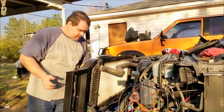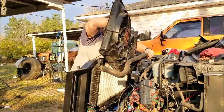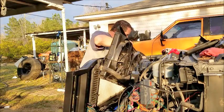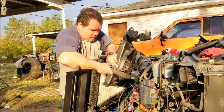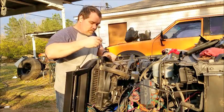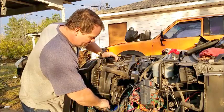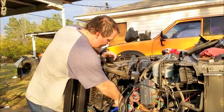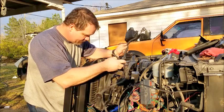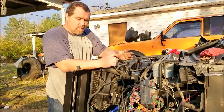The fan itself will fit — it might be a little tricky — but it fits right in, just as pretty as you please. It looks really, really pretty. A lot easier if you don't have the hoses on yet. Slips right there. Use the same bolts the old radiator used and you screw her in. Here's the harness that goes to it — those are your little plugs, and then it has a ground in it. They plug right up. This is one of the reasons I also use the factory harness, because it runs to everything without having to cut and splice it.